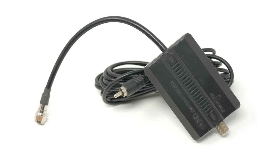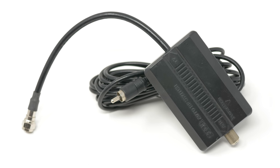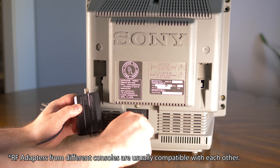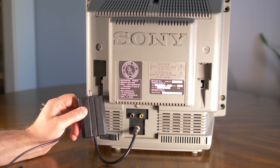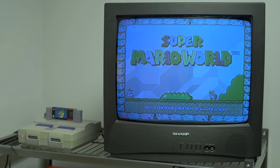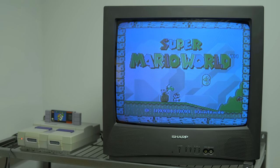The first cable you might see from most classic gaming consoles is RF, which is basically broadcasting an analog TV signal down the cable to your TV's coax input. This is the lowest quality of all the cables, and it only allows for mono audio. But if it's your only plug and play choice, like with the Atari 2600, you could make it work. Unless you live in a big city with lots of wireless interference, RF would look pretty clean on many CRTs.